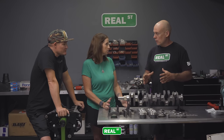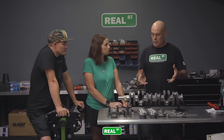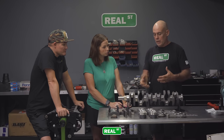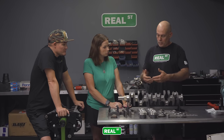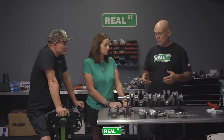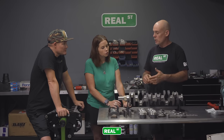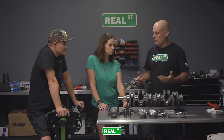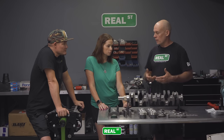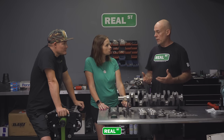So you're not limited. Yeah, you have to have a little bit of money laying around to buy a premium crankshaft. So looking at a crankshaft through the build process and the goal process, if you don't have the money for this, then you can start to simplify, and I would use a stock crank. Most Japanese engines can use a stock crank without any sort of catastrophic failures. All these Japanese engines for the most part are pretty tough.